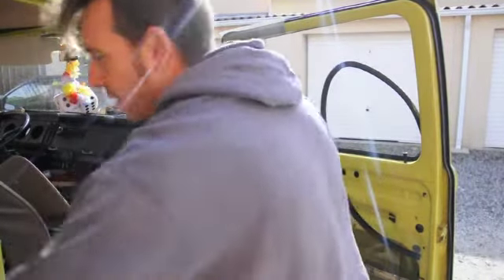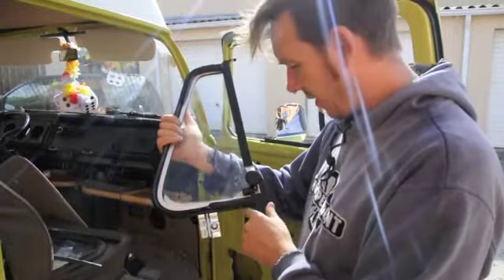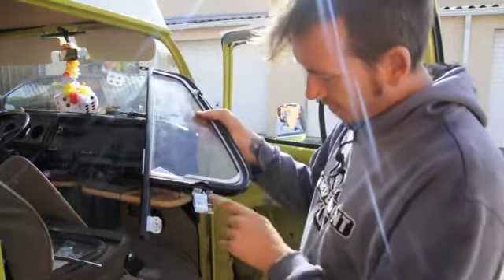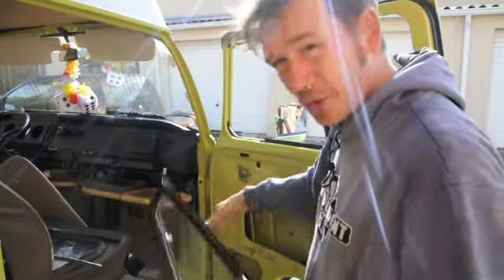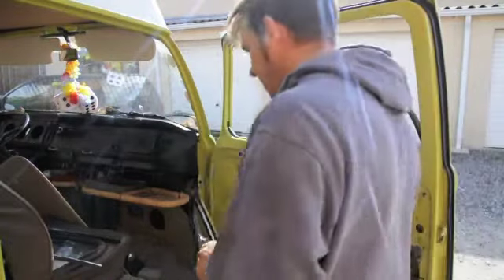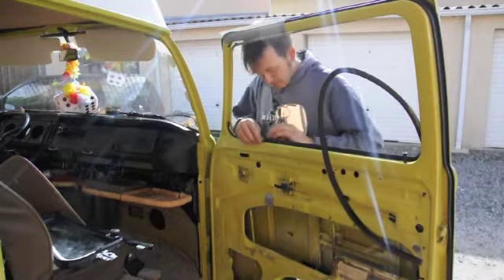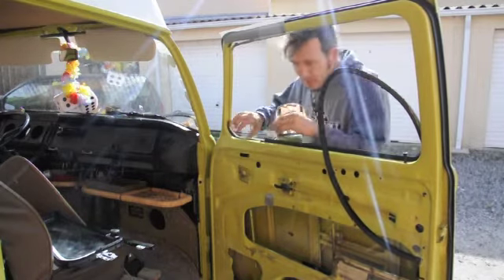So that's the quarter light assembled and complete. I've got it closed up to make it nice and easy to fit back in the van. I've tightened up the 10mm fixing on the bottom and I've put a bit of grease inside the channel here, because you can't get to this once it's back in the van. You don't want it going rusty and snapping off. So next job, you're going to pop it back in the van. The trickiest bit is getting it down between these two rubbers here.